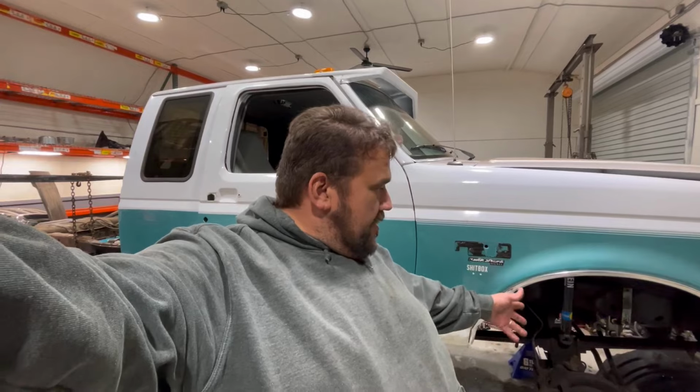The Dana 50 is sitting on a set of leaf springs. You get rid of it, and you put the Dana 60 under there. But the one thing that you unequivocally have to put in is the panhard rod, or the sideways stabilizer. Yeah, Laney doesn't have that. Whoever did this job apparently didn't know any better and didn't put it in.